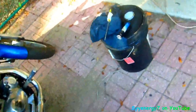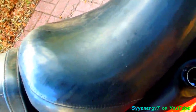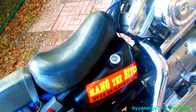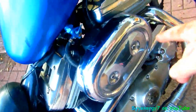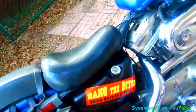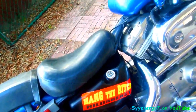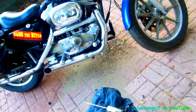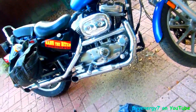Again, straight 50 weight — you don't want to fill it up to the full mark. You want to fill it up halfway between the add and the full mark, because when it's at the full mark, especially when it starts heating up, that's where you get that blow-by. You'll notice the blow-by dripping off your air cleaner because it's got too much. Harley Davidsons aren't really made to be run at full. You don't want to be at the add level, but between add and full. I've got that little oil cooler in the front, which helps — it's not overkill, just enough to do a little bit.